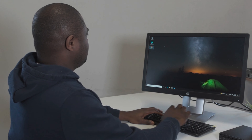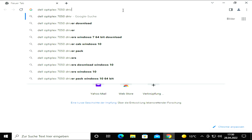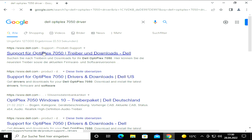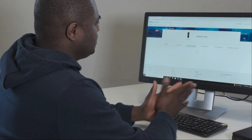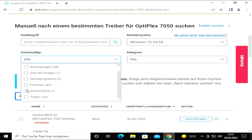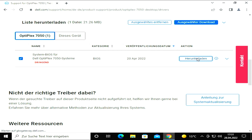To do this, hop onto Google and initiate a search for Dell Optiplex 7050 drivers. When the results pop up, click on the official Dell URL to avoid downloading any form of third-party or dubious BIOS file. In the case of the Optiplex 7050, the latest BIOS file is BIOS revision 1.20.0. Simply click on it to start the download process. Depending on the speed of your internet, the download might take about a minute or two.